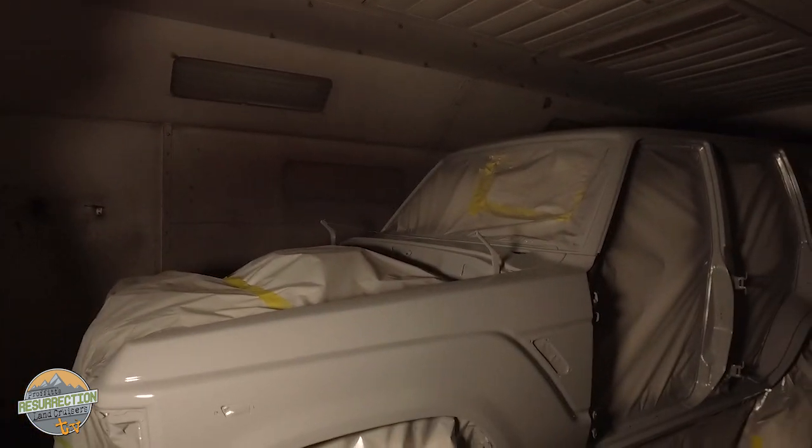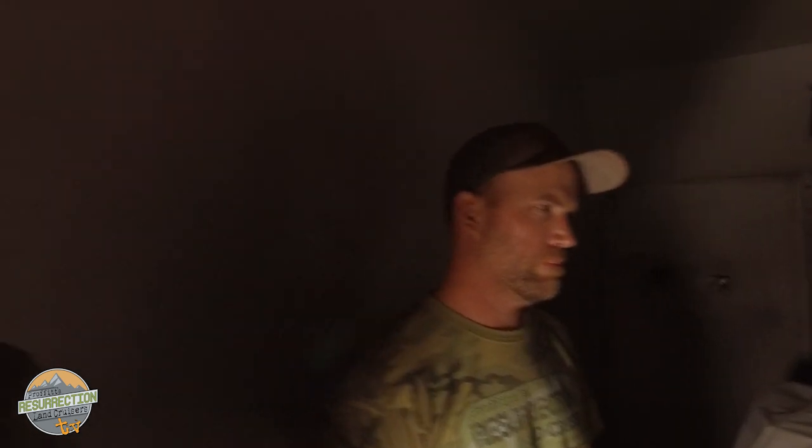Bob just sprayed what they call round one primer — a high-build epoxy primer that's good for bare metal and corrosion resistance. It's basically the best adhesion you can get from a primer. Then this all gets sanded and sprayed with another round — a primer surfacer that you can smooth out a little better, which is better to go under paint. Another FJ60 in here — the 60s and 80s are outnumbering the 40s now and will be less than 50% of business in 2022.